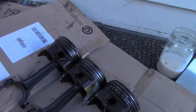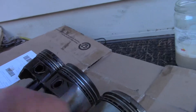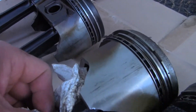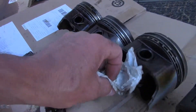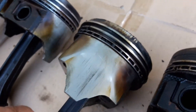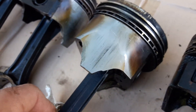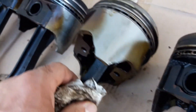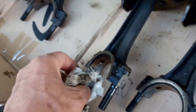Moving down to four — the compression ring is okay, it's not cracked in half. There is scarring on the piston. The journal is coppered and it's also a cracked skirt. The compression ring was okay but the skirt is cracked and scarred, and the cracks look like they've been there quite a while — probably longer than I've owned it. Scarring on the other side too. The journal is typical — it's coppered.